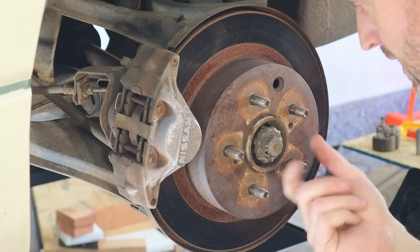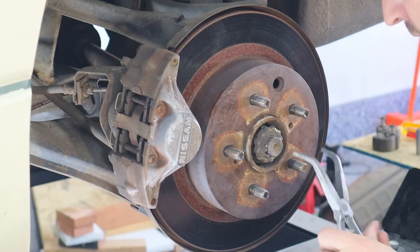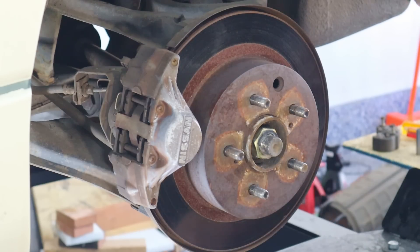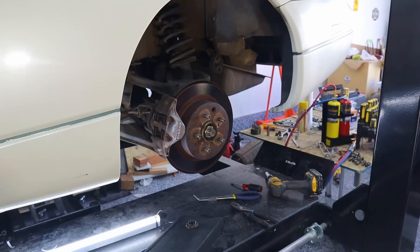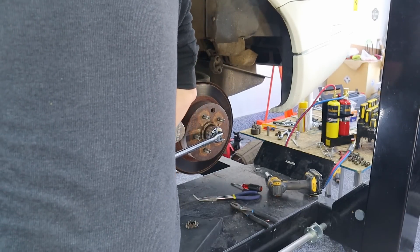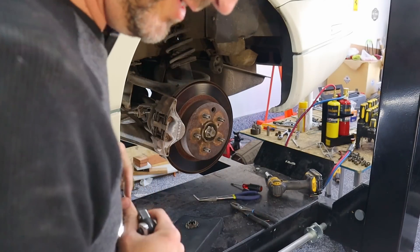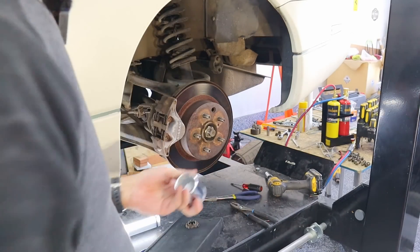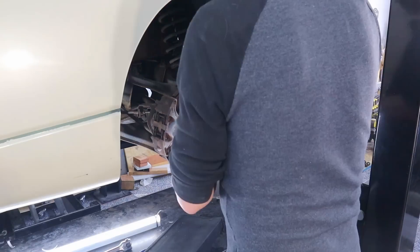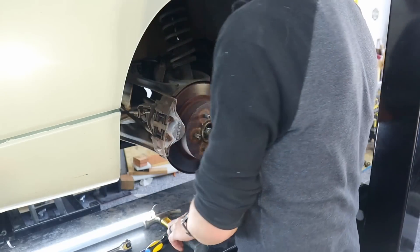This has a unique piece — I thought I'd need a special tool, but it's really just a dust cover that you can literally take off; no threads or anything. We're going to give this axle nut a try before using the torch. My guess is like everything else these axle nuts are always hard to get off, but this one did have a special dust cover so maybe that helps. Oh my gosh — I think I got it without heat! It's still very stuck but it's a 36mm. Boom — it's coming right out. These are like the easiest ones ever.